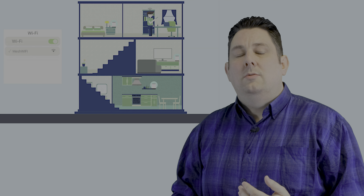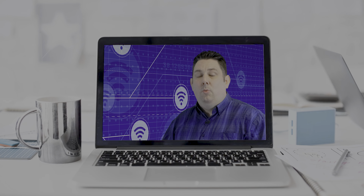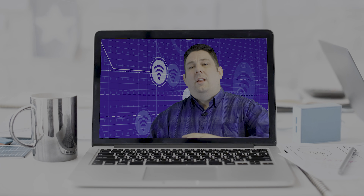Usually one centrally and then one a little bit further away. All these devices work together, so when you connect to the internet you don't have to put a different code in for each individual device — same wireless code, same connection for all of them. Your smartphone, tablet or laptop automatically connects to whichever node is closest or fastest. Your signal doesn't have to travel all the way from one end of your house to the router; it goes to the nearest access point, then from there to the next one, making a big bubble around your house.